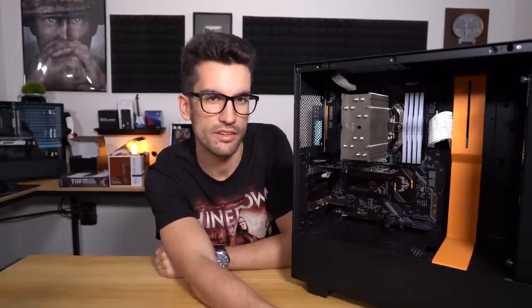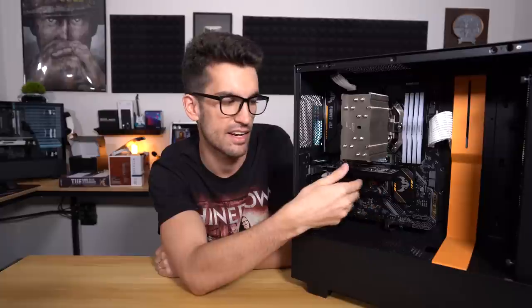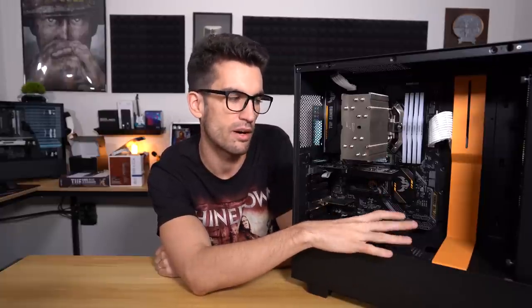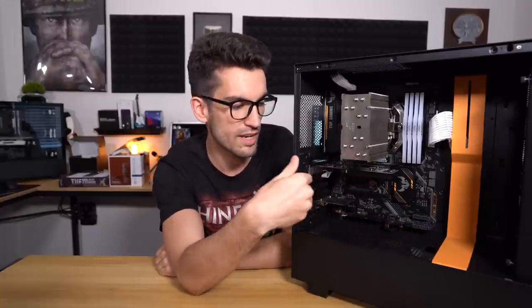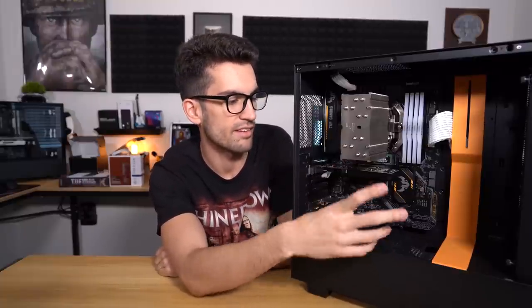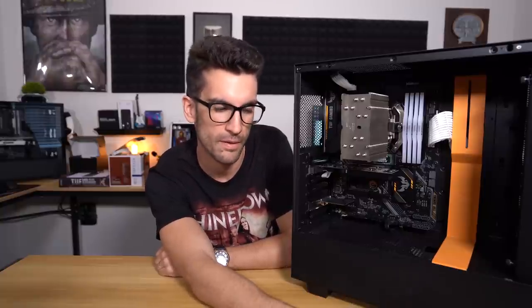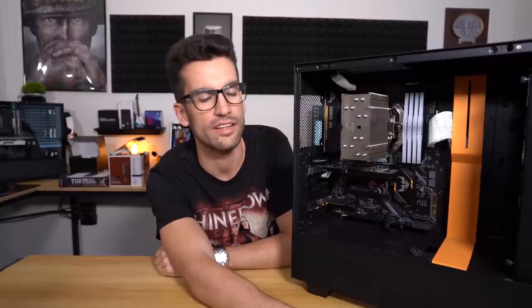There are several ways I could have done this. I could have shoved a really expensive high-end RTX 2080 or 2080 Ti into here and downclocked the crap out of that, because those already run pretty cool out of the box. And maybe that would have worked without fans. I have no idea, but what I went into this thinking was that the better performance per watt cards would be the ones to use here, and those still did not. We were running at 300 megahertz on the RX 580, and it still throttled, it still shut down the entire system because it reached over 90 degrees Celsius.